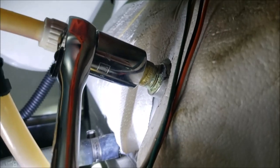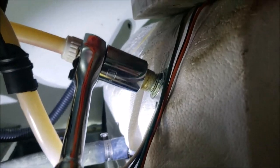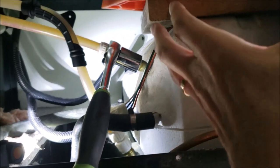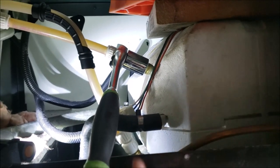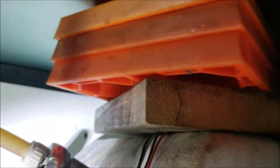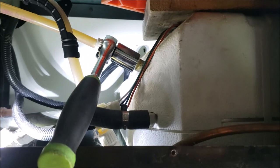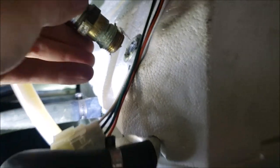This takes a one-inch socket, half-inch drive — check your toolbox and make sure you've got that on hand. The problem was every time I tried to break it free, the water heater was twisting and moving around and I was afraid I was going to break something off. So I wedged in little blocks and levelers between the floor and the water heater to keep it from moving, giving me enough leverage to break it free. That little trick helped out greatly.